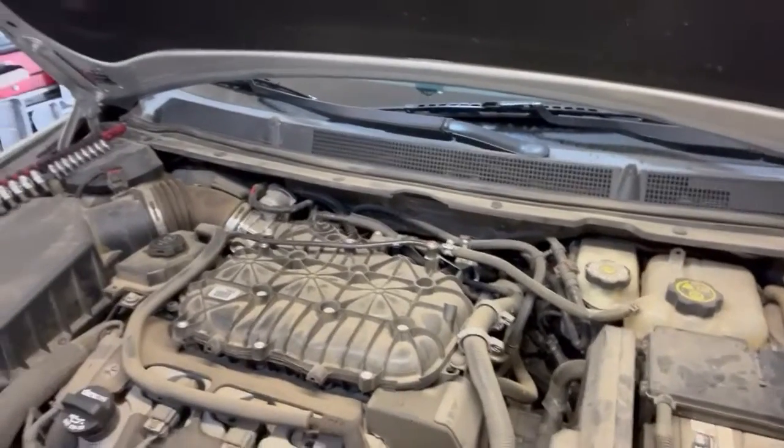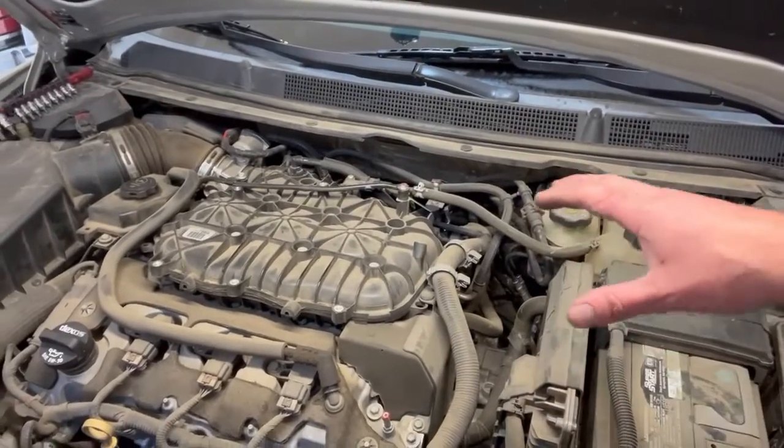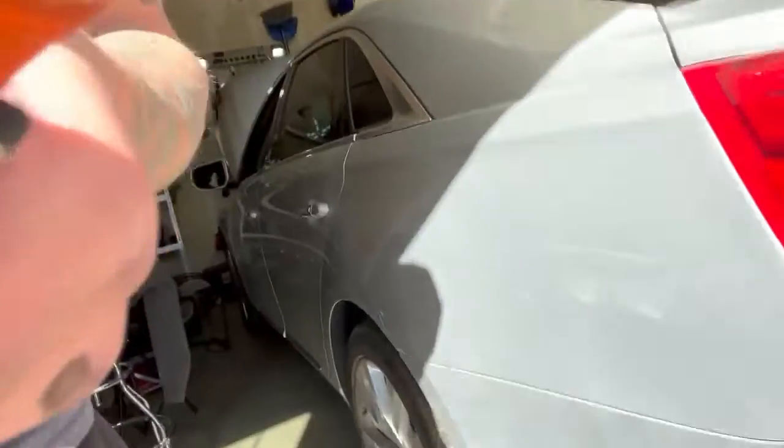I've got the cover off — it took a T30 to get the cover off. Something I've noticed: even though the engine is transverse, the way that they're labeled is just imagine the front of the engine facing this way, so this is still our left side and this should be our right side — at least from what I've come across with other transverse V6s and the way that they were labeled. Make sure when you're doing your smoke test to do it in a ventilated area — I've got the garage door open because you really don't want to be breathing this stuff in.